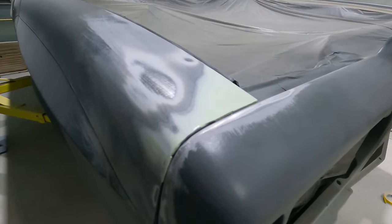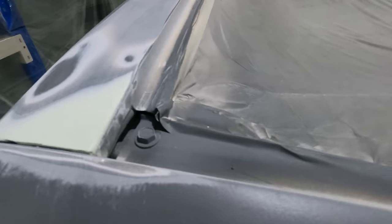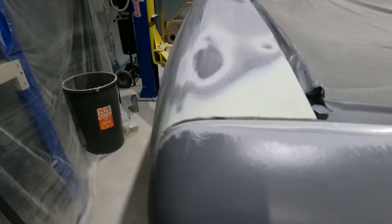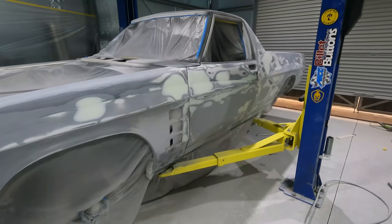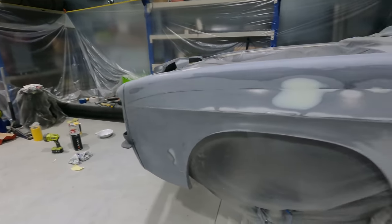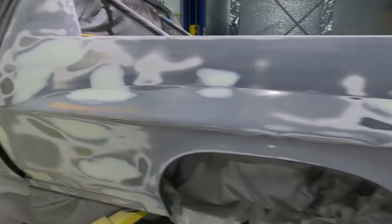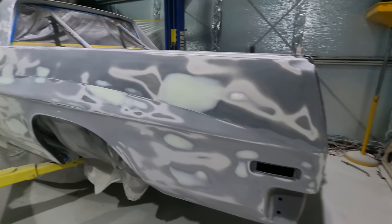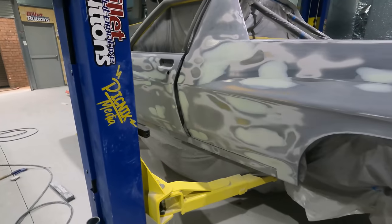I had to put a bit of filler here because it dipped down - the guard, I tried correcting it with the radiator support and stuff but for some reason it just wanted to pull down, so I had to put a bit of filler in there. I've literally just sanded this whole side, been doing filler all day - all the boring stuff. Actually ran out of the dolphin glaze so there's a few spots here and down here that need more, but I've got all the main stuff covered. I'm going to put another coat of all-you-need on just this side and hopefully it's pretty close to bang on.